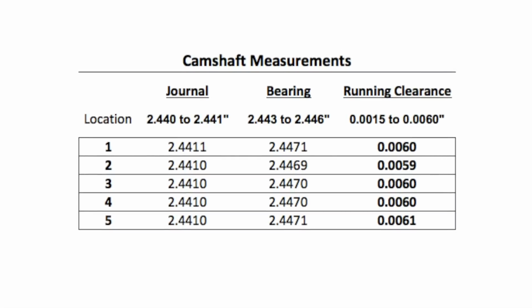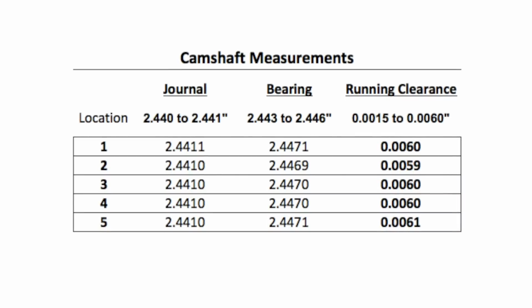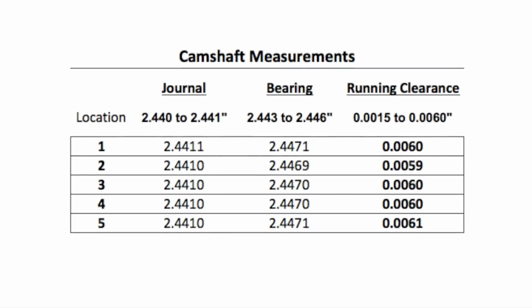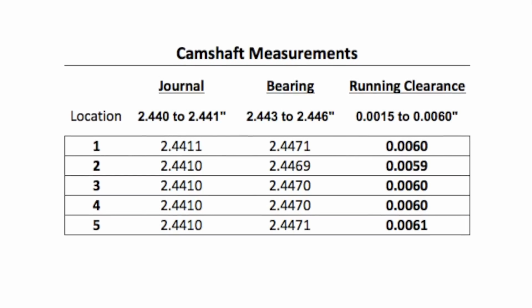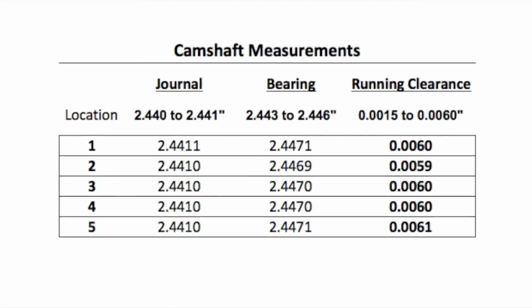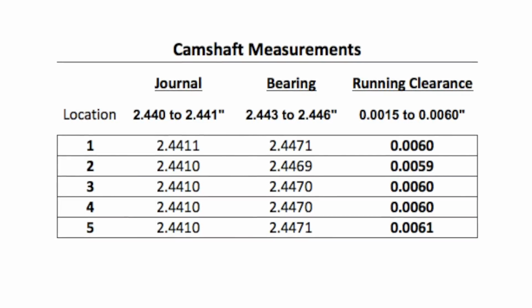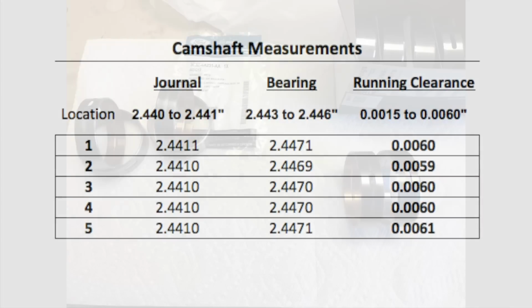That allows for more oil volume to escape, and therefore lower oil pressure, which will only get worse over time as the parts wear. With these bearings having this amount of wear at 75,000 miles, and with the fact that these are the only OE bearings in this rebuilt motor, my gut feel is they never changed out the bearings when the motor was rebuilt.